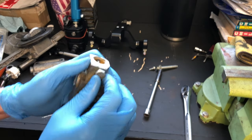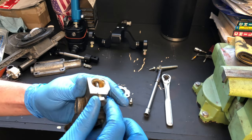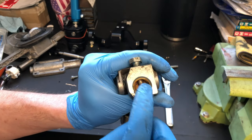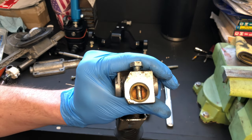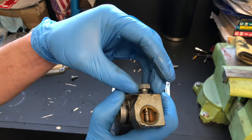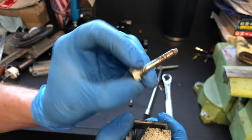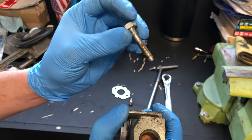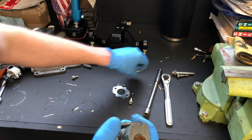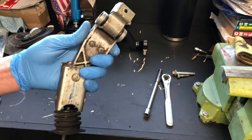It's a pretty interesting bolt — I ended up using just a 3/8 ratchet with a 13mm shallow socket to get it loose, no problem. It almost acts as kind of a pin going into the shifter shaft that goes into your transmission. Once you get it loose, you may have to use a pry bar to work it out of there. You will be reusing this bolt — it's going into your new MGW shifter, so hang on to it. From what I understand, you won't be utilizing any of the other factory bolts.